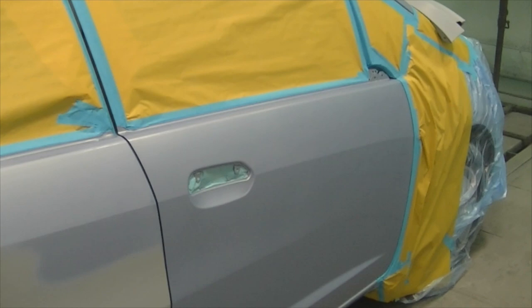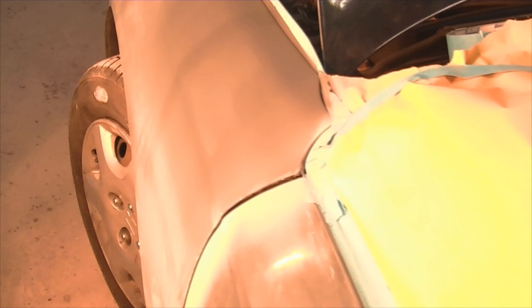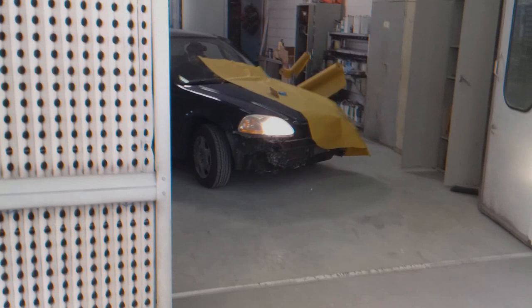Jimmo here again with another great video. Today I don't have the honor of spraying the blue Nissan — instead I get the privilege of doing this old rusty green Honda, which is just a diamond in the rough. We've replaced the fender with an aftermarket part that came pre-dented, so you get to fix it for free. I've also just replaced the filters on my cross draft booth where I'll be spraying — they were pretty clogged and it's made a significant difference in airflow and keeping jobs clean. My exhaust filters have been on back order for months, but here comes the Honda, so let's get at her.